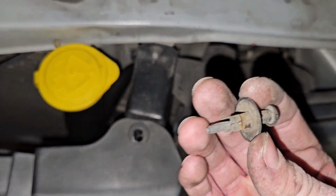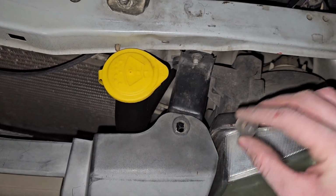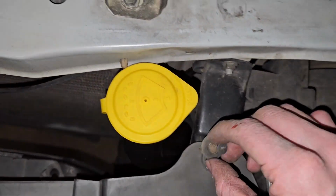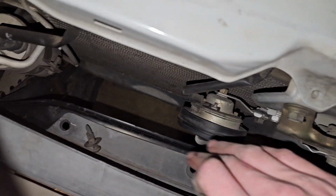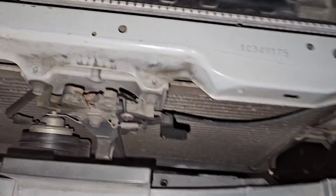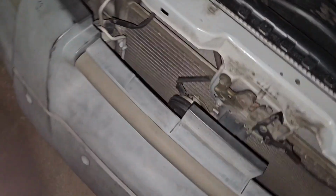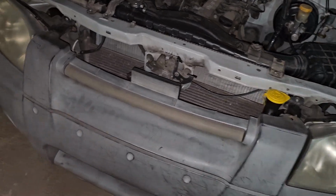We have these things that are kind of like clips, but you can screw on a little bit. Yes, I'm bleeding. I don't really know why, but you're supposed to have 6 of these. So you'd have one here, you'd have one there, one there, one there, and one there, and then the last one on the other side over there. So unfortunately for me, I've kind of lost like 2 of them, so I'm gonna only have one there, and on both sides with like a loose screw. But that's how you'd want to remove the front part of the bumper here.